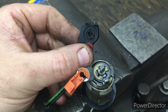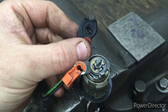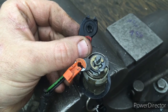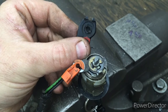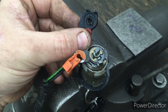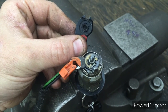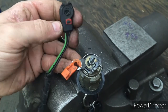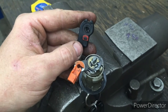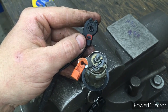And as I understand it, if you're using your automatic locks with the fob or the interior door switch, you're locking all of the doors at once or unlocking them all at once. So if you lock them all at once and then you go in to try to use your key, only one of the doors is being unlocked rather than all of them, and that's what's sensing the problem. So I think that's what the issue is. You could have these electrical issues, or these things could be damaged. But if you disconnect these, I'm hoping that fixes the problem.